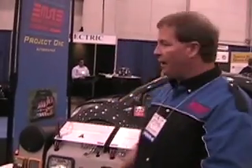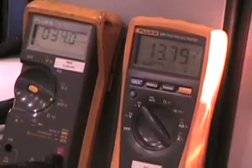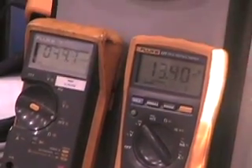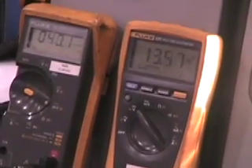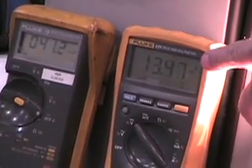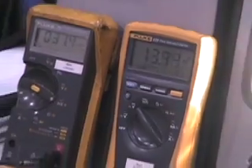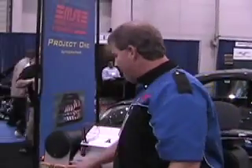Well, we've got a cap here — we'll see if that helps. The headlight dims. Take the cap on. Didn't help the headlight. It helps stabilize the voltage about two-tenths or so. So the cap helps a little bit, but not much.